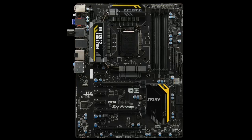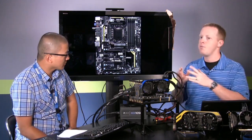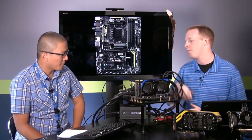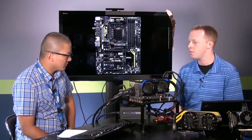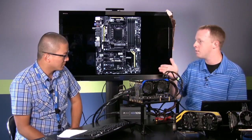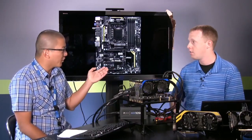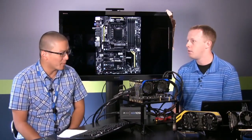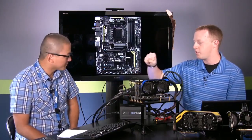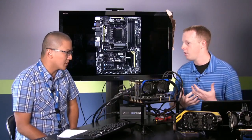Normally, if these graphics cards are directly abutting, there are some cases where a GPU cooler that has a taller fan than normal might start to interfere with touching other components. So you can still put another device in there if you have a by 1 sound card or something you have to use in that spot. Even a Wi-Fi card, for example, some of those Wi-Fi cards are by 1 slot and very small, low profile. And you can still have 2 GPUs in there, or if you don't have that slot there, then you have a little bit better airflow through the system.